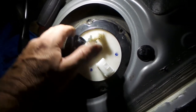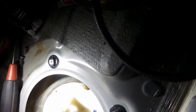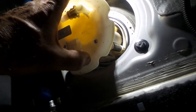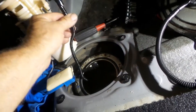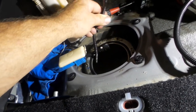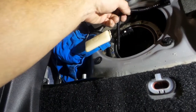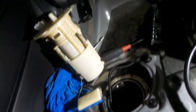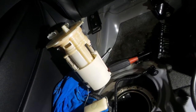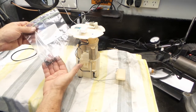Once you get that last screw out the whole assembly will pop up from the spring tension - be prepared for it to pop up so it doesn't freak you out and make you drop something. I'm going to have to ditch the camera just to get this out - it's impossible with one hand. When you get it out you've got your connector hose which siphons across from the other tank, and your float to contend with. Just be really careful turning it as the ridges on the pipe get really jammed on the edge of the hole. The fuel tank cover screws are safely tucked away in a ziplock bag.